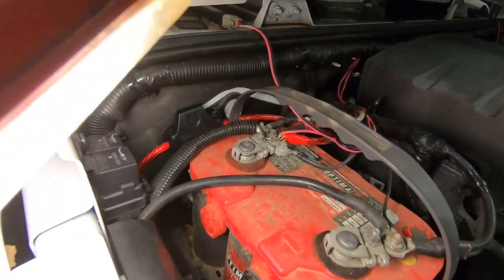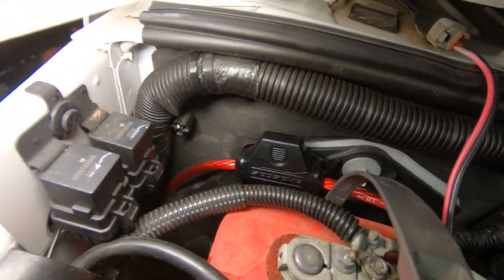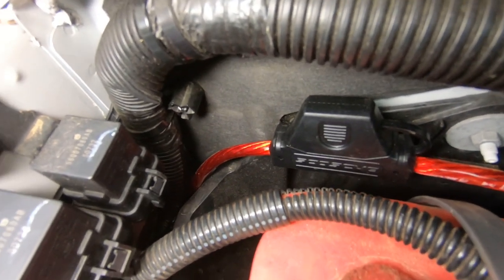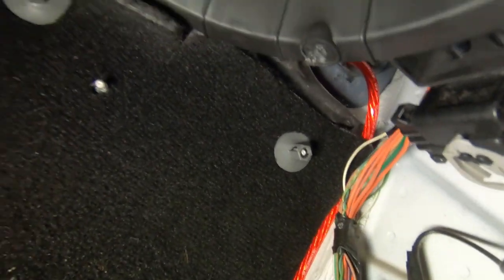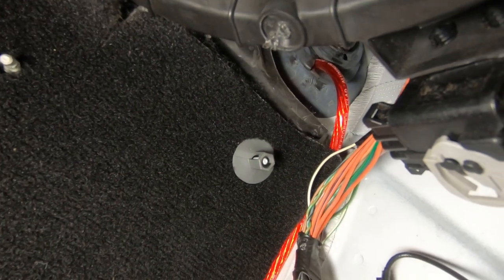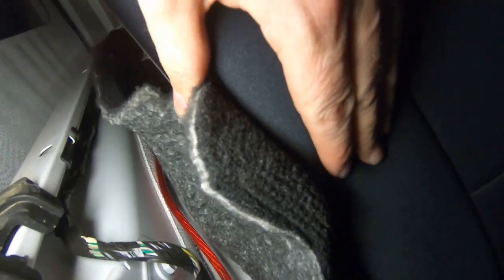Here's a little update on where we're at. Got the power wire hooked onto the battery — positive post — looped around, the fuse holder is sitting right there and the fuse is removed. I tipped it down behind the battery tray in the corner, then removed the inner fender well liner. Found a convenient grommet right here that passes through the firewall, so I ran it through there. It's coming through here — remove the trim panel and I've got it running along the trim panel, then along the power cable going back, through the B pillar, up underneath the carpet.